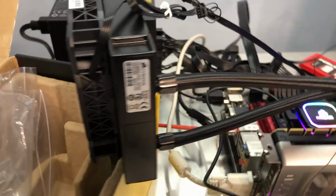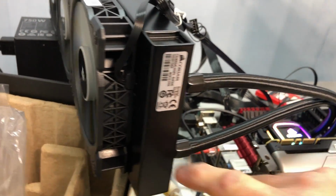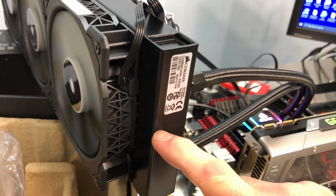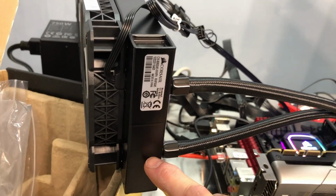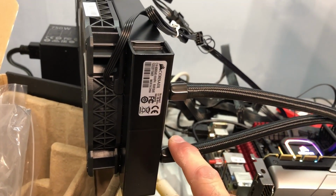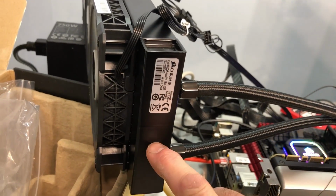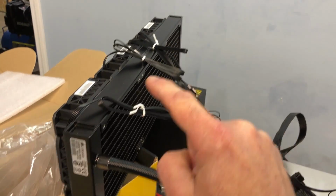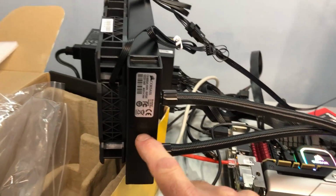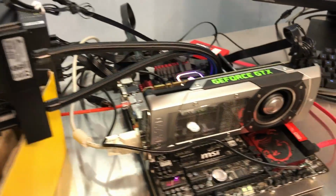And the reason we see that bottom half of the radiator, or this section down here, warmer is because if you see right there, there's a little dimple, and there's actually a little baffle right there, and that keeps the water from going from the inlet here to the outlet. It can't just make this loop. You don't want it to do that. You want it to go in this side of the radiator, trace all the way down to the other end, come back, and exit here. So that's what the little baffle right here is for. And that's why you see that distinct temperature difference on the bottom section of the radiator. And everyone I've ever seen has been exactly that way.